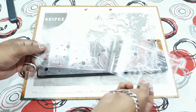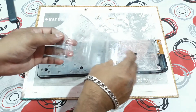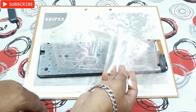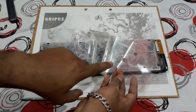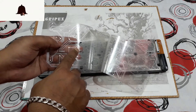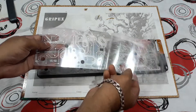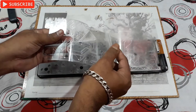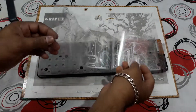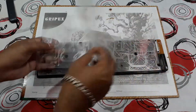This plastic film-type thing has a design of the keys and connection lines on the bottom layer. At the top there's another layer, and the middle one just has holes where the keys are. When you press a button, the point at the top layer touches the connection at the bottom layer through the holes in the middle partition. That's how the keyboard works, and if there is dust on these connection lines, the keys might not work.